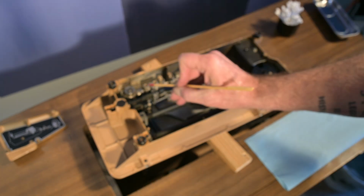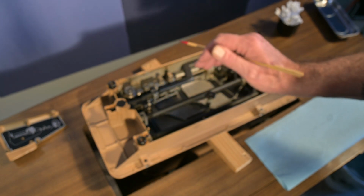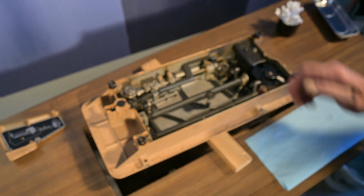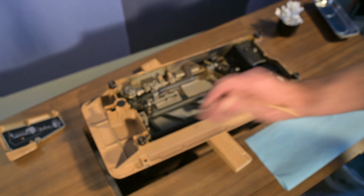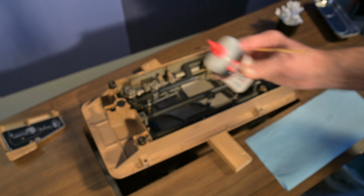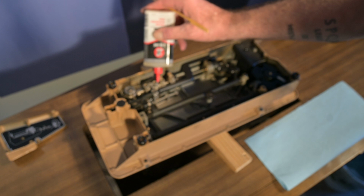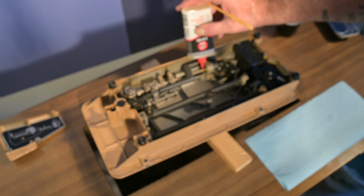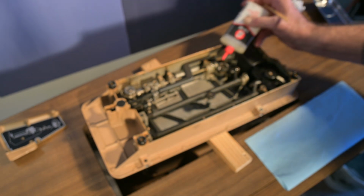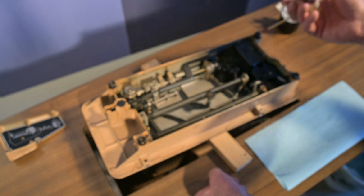While we're here, these screws are for adjusting either mostly the needle position, maybe the vertical needle position as well. But anyway, I'm not going to oil those today, but I am going to drip a bit of oil on that fluff there and all that hair, just to kind of coagulate it and get it together. And then I'm going to go there, like that, and I'm going to go there in all these joints. That's what I'm doing. And I end up there, and there, and there. I will put some oil on the gears right now, but they will get grease as they require.